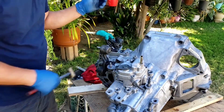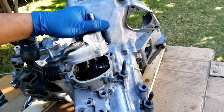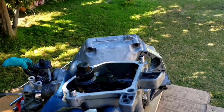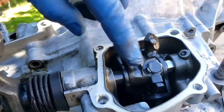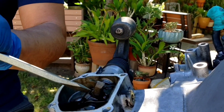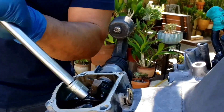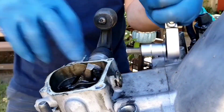Now I'm ready to pop this — this is the lid. There are places where you can just give it a pry right here; it's only being held by some sealing. There it is — this is the spring I was telling you guys about. It creates tension, and if you're running that cable setup it sends tension that will bring your shifter back to neutral faster. I might just do that. I've been reusing these seals — no problem. All I need is to back it up with a screwdriver and give it a tap, just enough for the socket to go in. Since this one's made out of steel, just go ahead and give it a smack. There's the allen bolt you need to remove.